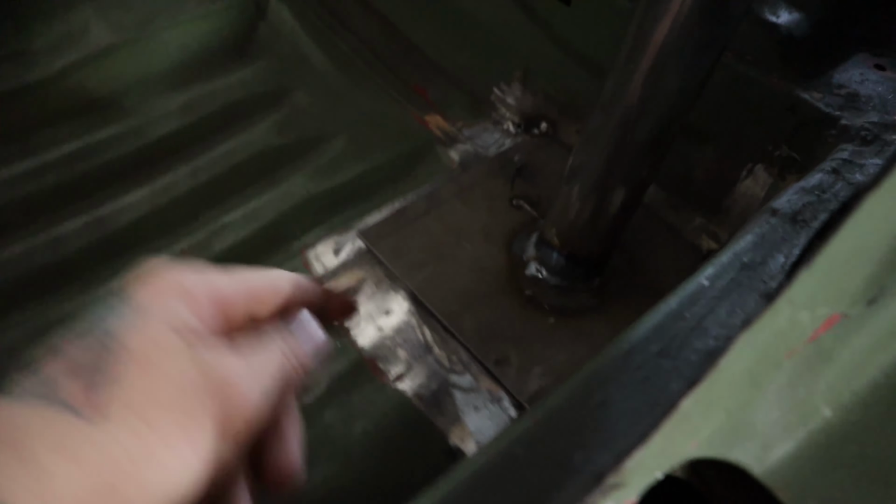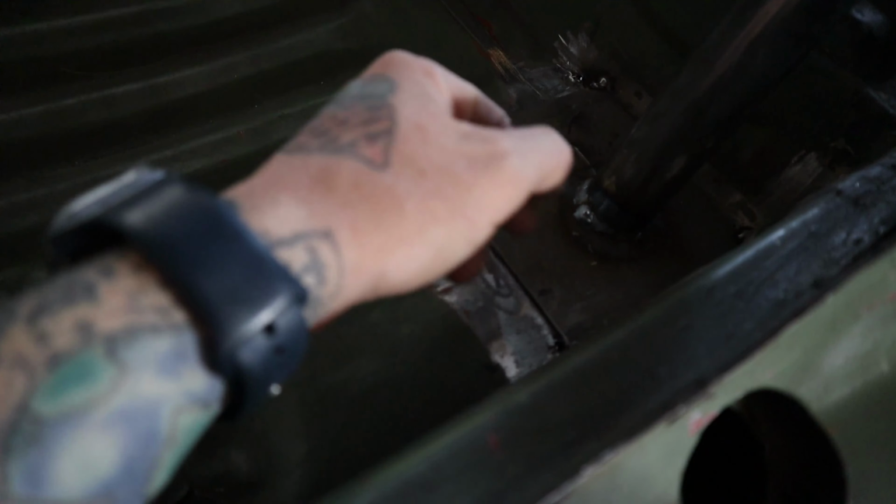So the dash bar goes across there to there. I'll have to move his tachometer. The floor plate's not fully welded in yet because I do have to go under the car and prep the chassis because it's spitting and hollering because there's all the paint and seam seal underneath. So I just go underneath with a wire wheel and clean it all up with an angle grinder.